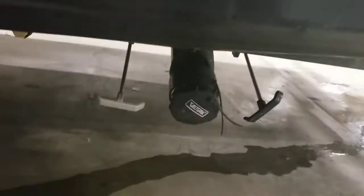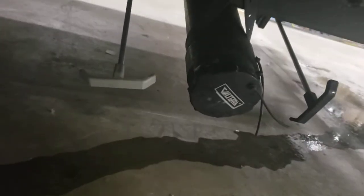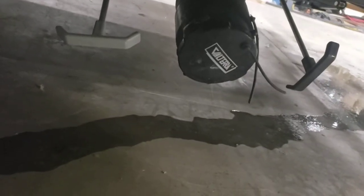Below that, you get your sewer. On your left is your gray. On your right is your black. I always make sure these are all the way closed. You just push them and pull them all the way closed like that before I take this cap off, because that section is going to be filled with some residue if you've left these valves open.